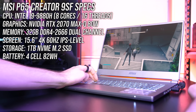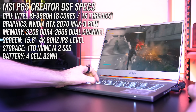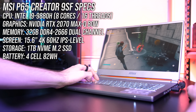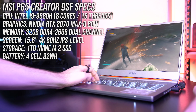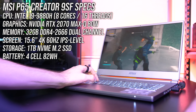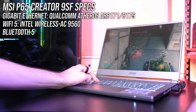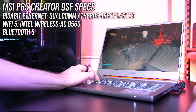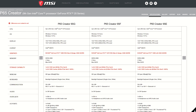I've got the 9SF model. So there's an 8-core Intel i9-9880H CPU, NVIDIA RTX 2070 Max-Q graphics, 32GB of memory and dual channel, a 15.6-inch 4K 60Hz screen, and a 1TB M.2 NVMe SSD. For network connectivity, it's got Gigabit Ethernet, Wi-Fi 5, and Bluetooth 5. You can find updated prices for this and other configurations linked in the description.